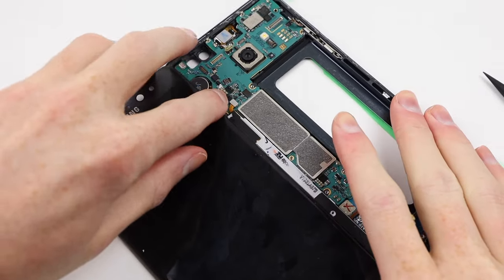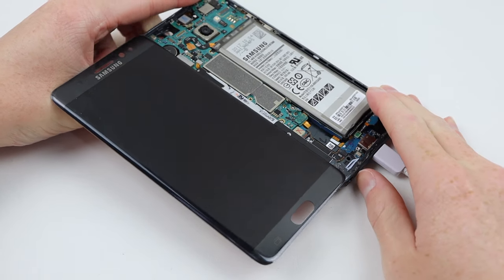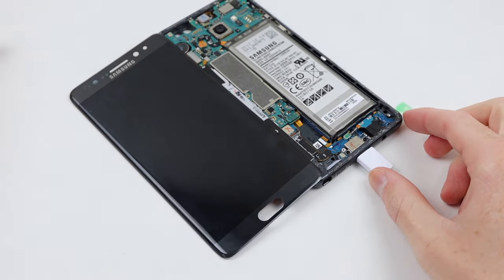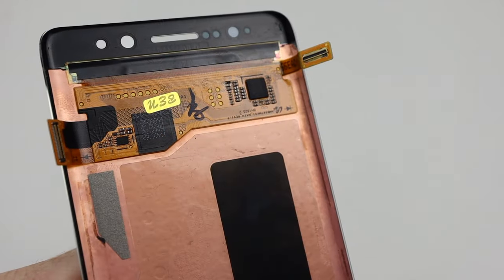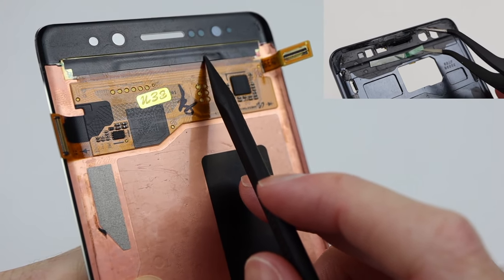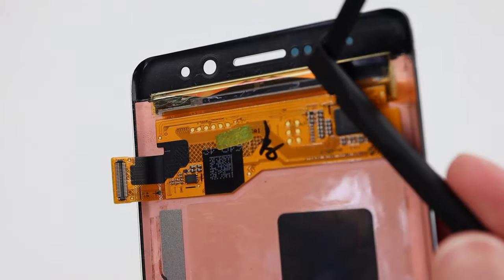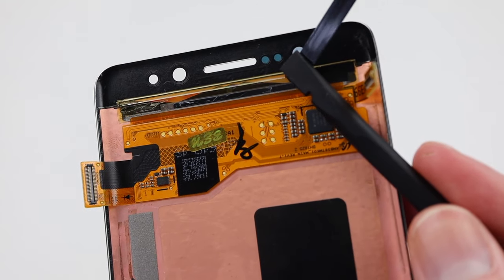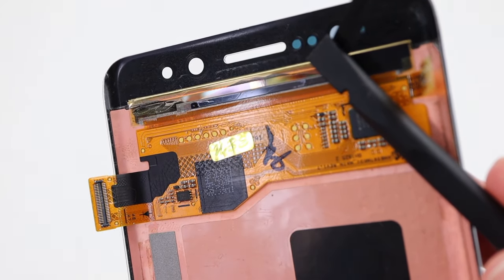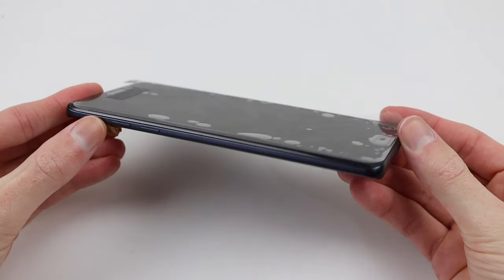Connecting the motherboard, screen, power button, and dock connector, then reinstalling the battery and plugging in USB-C — the screen doesn't work. I'm seeing nothing on the display panel, which is quite concerning as it was functioning fine just before. Taking off the display for a closer look, it's clearly a replacement from China. I also notice an imprint where that adhesive was under the display, which got me thinking — was it there for a reason? Removing the plastic film, the glass underneath is entirely shattered. It appears that piece of plastic was applying pressure and making the display work. Unfortunately there's no way to fix this panel, so I had to source a new one.